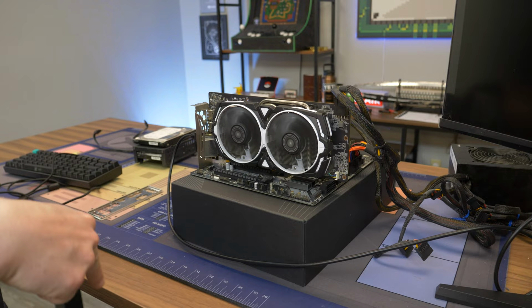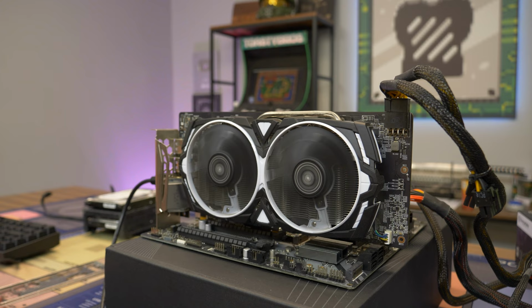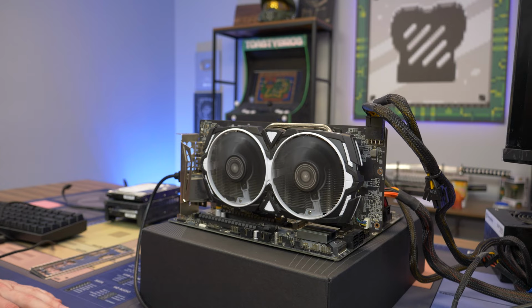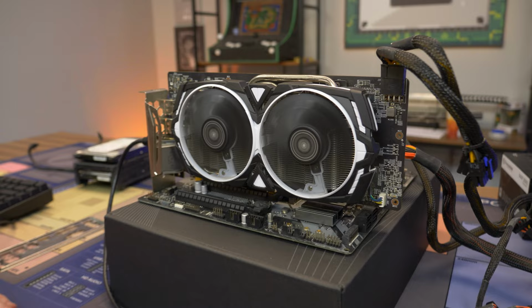Whenever you hear the fans ramp up like this, full speed, and not go back down, normally how it'll work is you turn your computer on, the fans are slow, they ramp up because the BIOS is not controlling them. They go 100%, they have full voltage, and then they come back down normally. This is not the case though, which definitely worries me because it could be the graphics card still, but... the GPU BIOS is corrupted or...